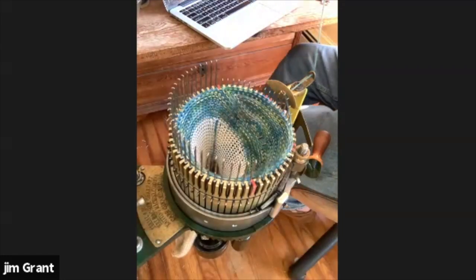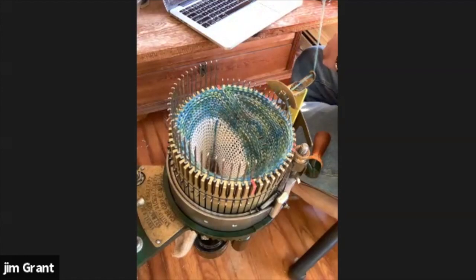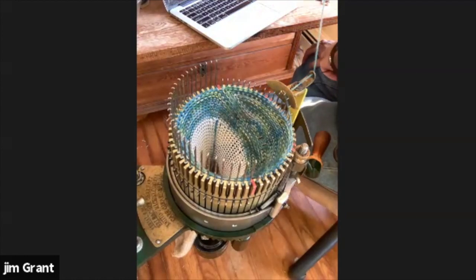Okay, I'll wait. So I have this knob off. Yep. And the bat thing needs to come up. It's going to come up hard. Take the whole thing off. You should be able to move needles around. But this won't move. Don't crank it. Just pull the V-cam out. You don't need the spring out. Now you can get to the needle that's trapped behind it, right? Yeah, it's right before it, but I can't pull it out.